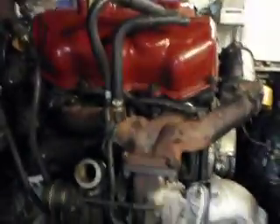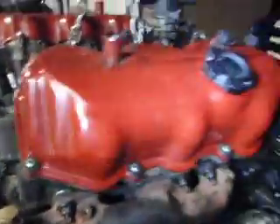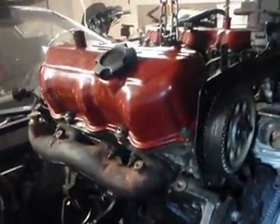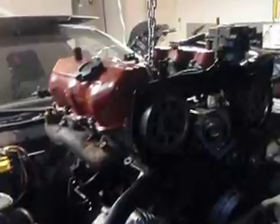As far as everything else, it was pretty much bolted up. I had to switch around the exhaust studs on the other side and drill out two holes in the exhaust manifolds with a half-inch drill bit. I also swapped the cams from the VG30ET to the VG33 — Pathfinder cams are a little bit smaller than the Z31 cams, so I went ahead and swapped them.